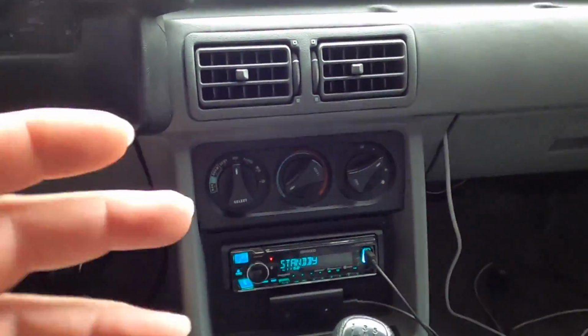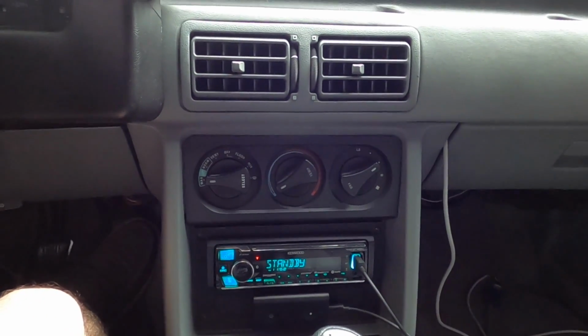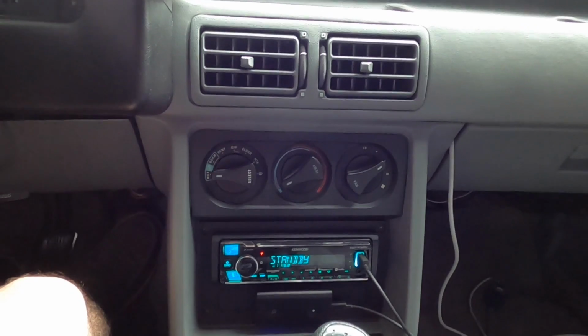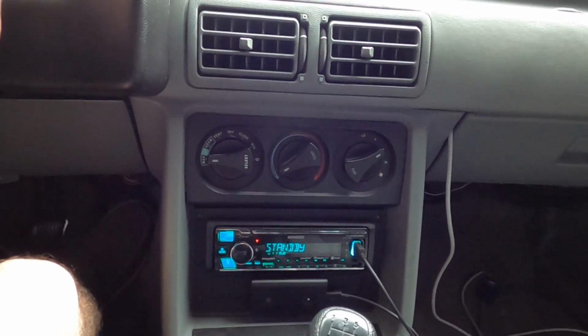The easiest way to do that is to turn your AC on, turn the steering wheel one way or the other, and if the car dies, typically at that point, you're gonna have a bad IAC. So when you have everything set correctly, you literally can come in here, turn your AC on, and the car does not really fluctuate. So that's the good thing about having your idle air control and everything else set properly.